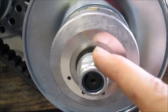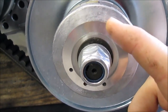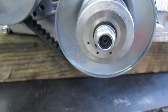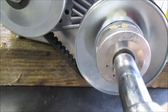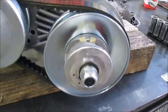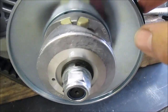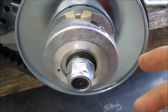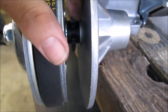Next up is your bolt. If you get your torque converter brand new, this will only be on finger tight. You're going to tighten it down with a 24 millimeter. I've already tightened mine down — it may come to where you need to set this on the go-kart itself or the mini bike, hook the chain up to it, and then tighten it with the wheel sitting there. You'll have to go back a step if this is the wrong sprocket.